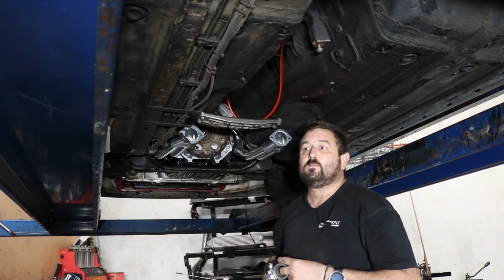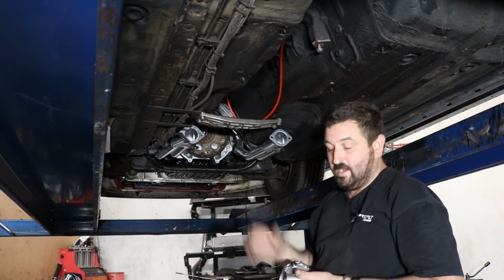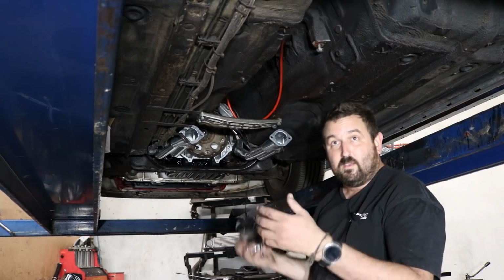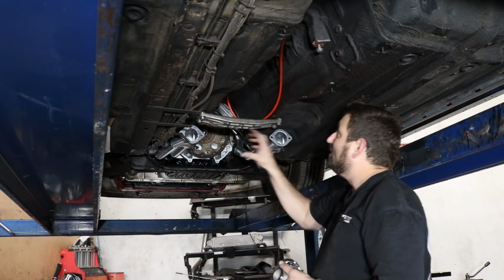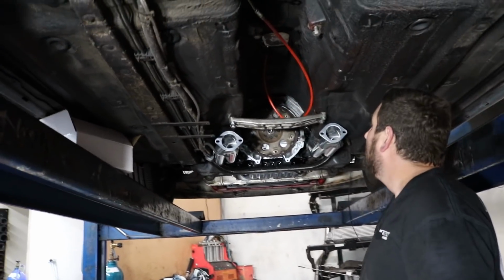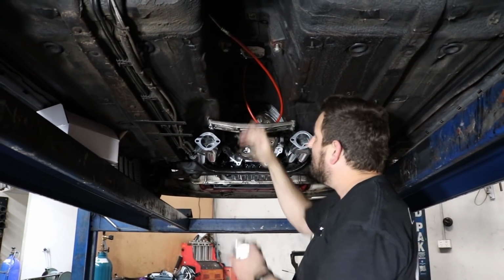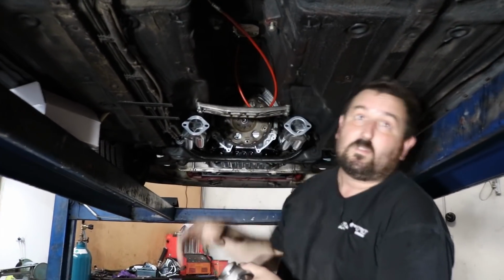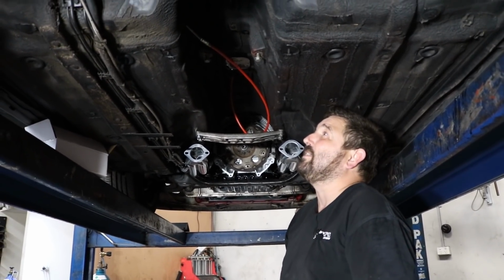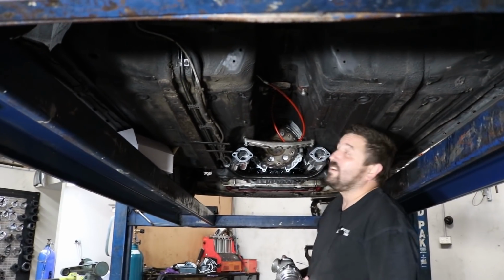So the wastegate's into a single pipe? Yeah, but that's purely because I don't really want it to sound like a cackly V8 with an unmerged bank to bank when the gates are open. And I've got this nice pocket in the middle here where it's going to have a heap of room, so it'll go twin 2-inch in the middle, twin gates in the middle to a 2.5-inch hot dog. That's my plan. Screamer dog. Screamer dog. Patent pending. Pretty much done on every car I've ever owned. Screamer dogs are awesome. They do. I don't like stuff loud.